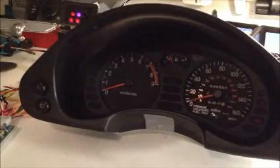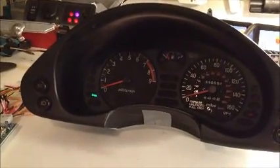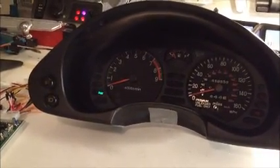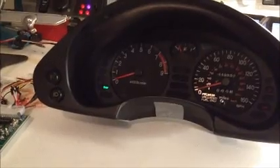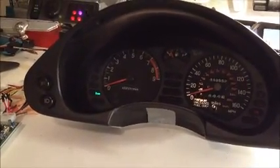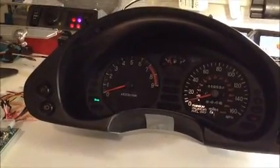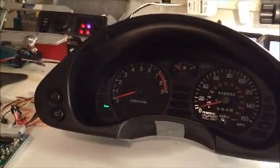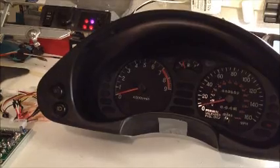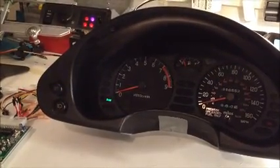Notice that the sport light just started blinking. That's saying that the controller detected that one or more of the struts was not able to go into hard mode, but that one or more of them are. So it's indicating that some of them are hard, and if you see a blink, then there's a problem with some of the others. I've set the frequency of how often that blink occurs to be not very often, so it's not completely distracting.